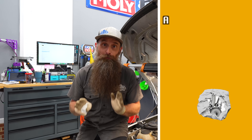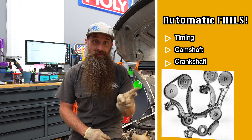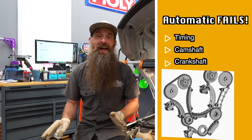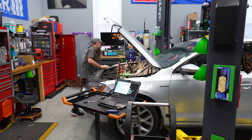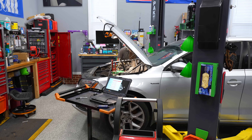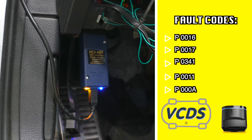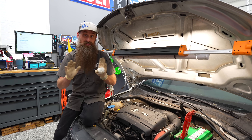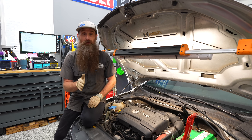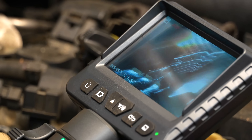While that loads up, here are some things to look for. If you pull faults and have any fault that says anything about timing, camshaft, crankshaft, or anything like that, you can almost guarantee you have a severe timing problem - your timing chain has worn and it's time for all new parts. That's going to be a P0016, P0017, P0341, P0011, P000A. Pretty much if it says timing, deviation, or correlation - that's another red flag word - you've got problems.